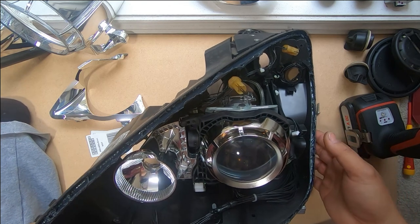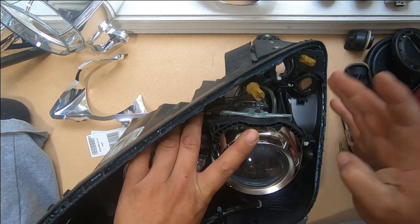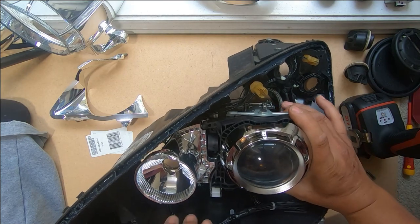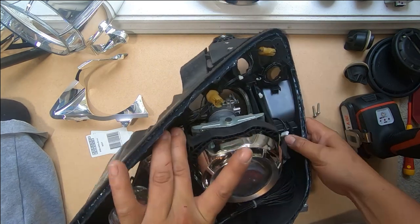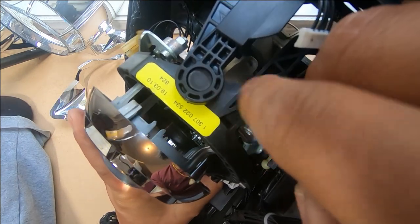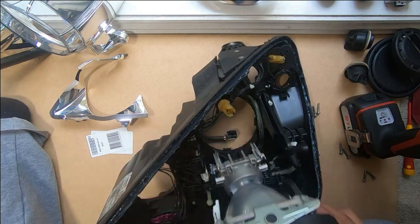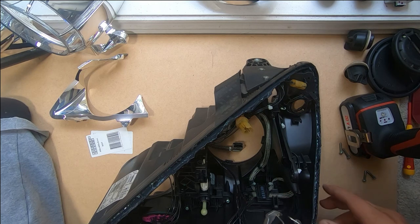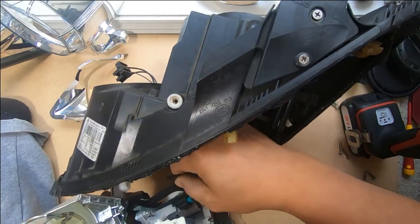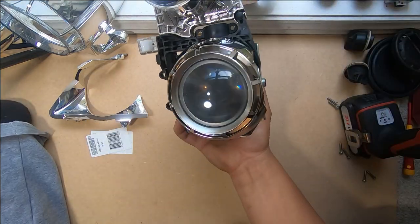Don't just go for gold — there is a specific way to remove this headlight. First we loosen it and then push it up, because there is a locking ball underneath. This sits on top of a ball that allows it to swivel, so we need to lift it up. Once we lift it up it comes off, and that is your headlight adjuster right there. Then we pull it out and the headlight will come out. Now it's just a matter of unplugging the two plugs — a black one and a green one.